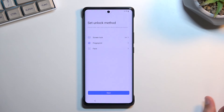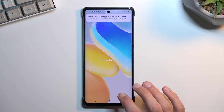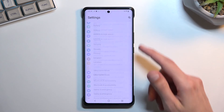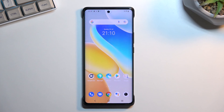It will take a couple more minutes but at that point you can be absolutely certain the device is fully unlocked. From the home screen go into settings, scroll all the way down to system, select reset options, then choose 'erase all data — factory reset.' That's the last step. And that's how you bypass the Google verification on this phone. If you found this helpful, don't forget to hit like, subscribe, and thanks for watching.